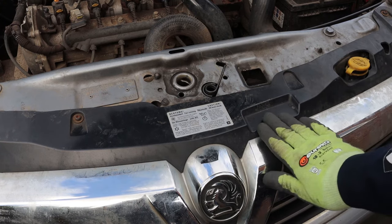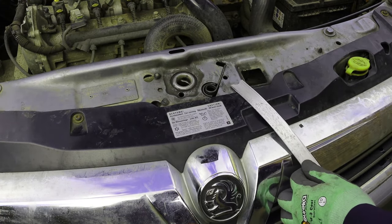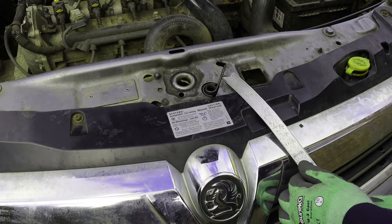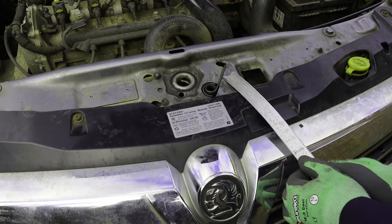What you're going to do is go in where you'd normally put your hand to release the bonnet, and when you push it forward, what you're aiming to feel is that you're hitting that bit there. You must make sure the aluminium is thick enough that it won't bend, but if it's too thick you won't be able to get under that spring.